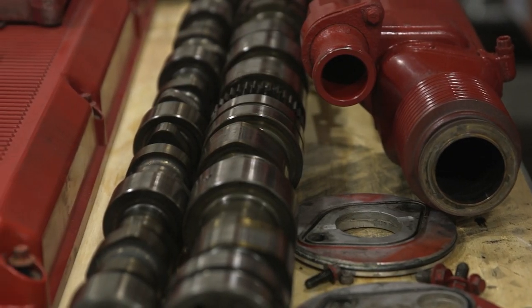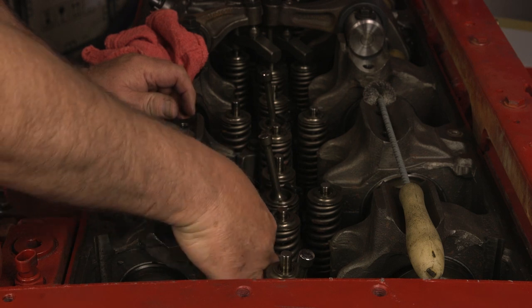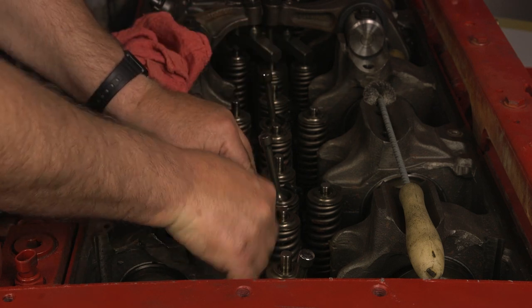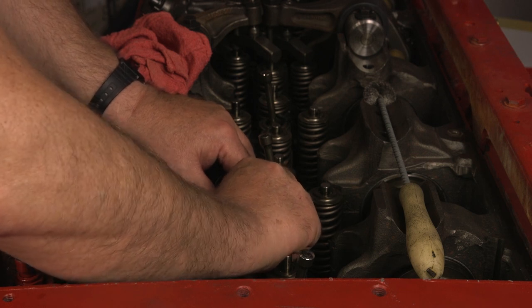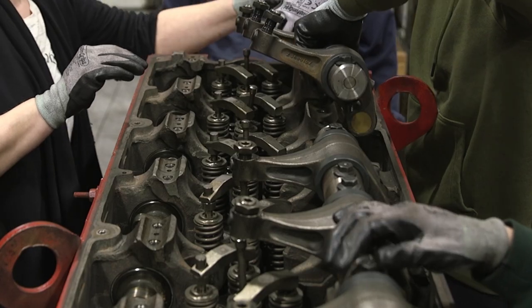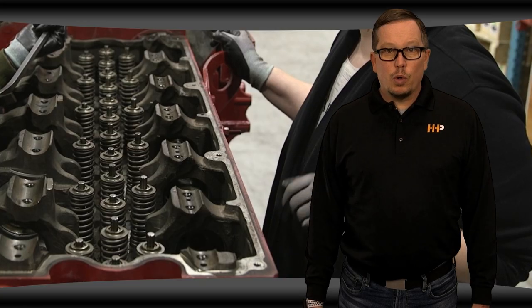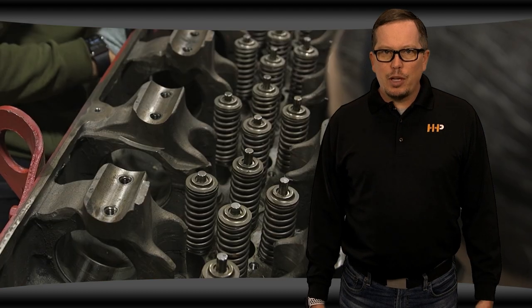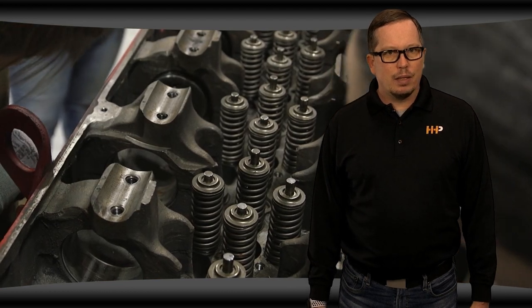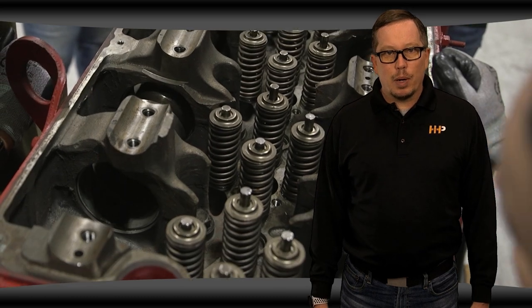It's a good idea to take a look at your ISX camshaft when you have it apart for an overhaul. You might not think you need to take it in to get the valve adjustment done because it's running fine, but you might have valve clearances expanding or contracting. This can cause the cam rollers to beat on the cam. So when you're doing an overhaul, take a look at your lobes and your rollers. Make sure they're in good shape before you put it back together. They can and do fail, and it's a lot of work to take it back apart to change a cam.